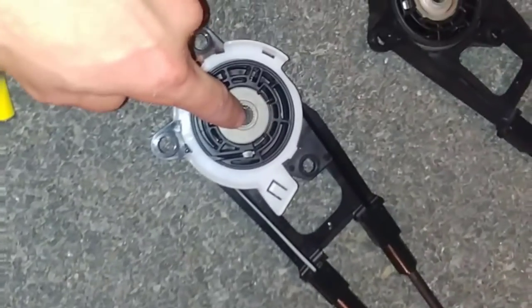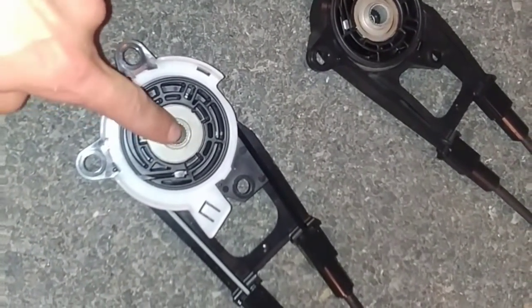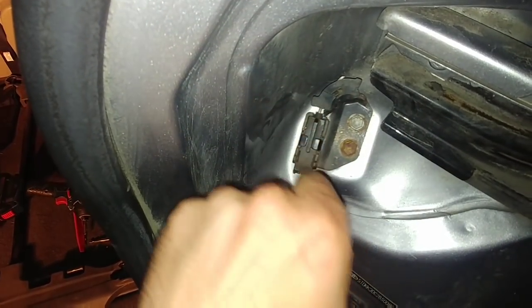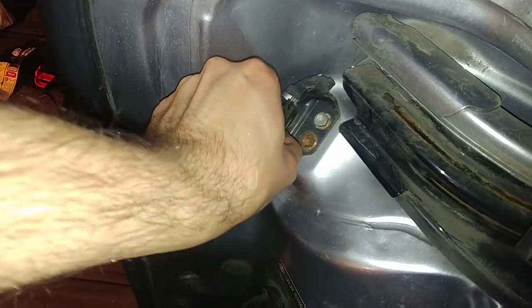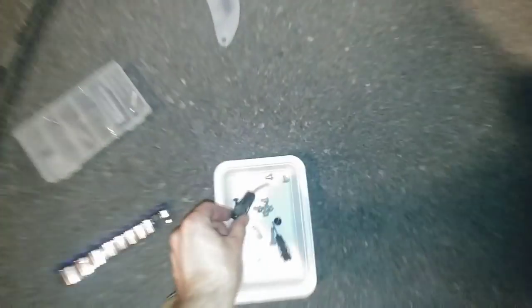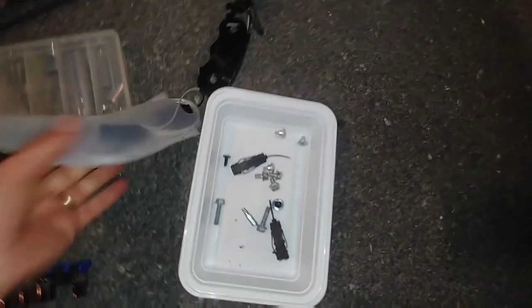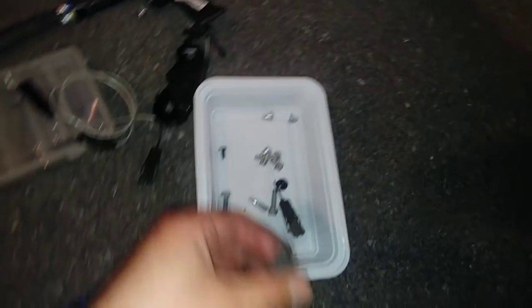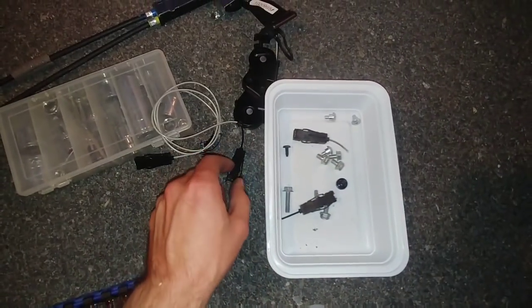Make sure you take off the white bracket holding the pulley wheel before placing it onto the motor in the door. Before putting the new one back in, the short wire end goes into this spot on the bracket — you can pinch the sides and shove the holder back out. It's actually nice that it's color-coded: the silver cable goes in the close bracket by the door, and the black cable goes in the one at the far end.